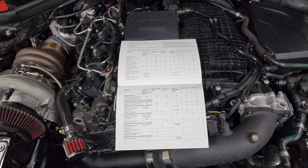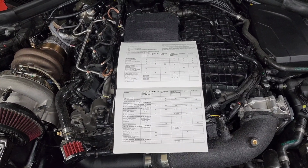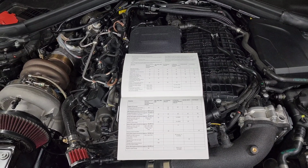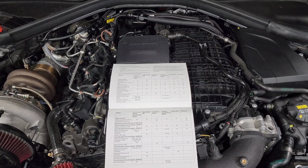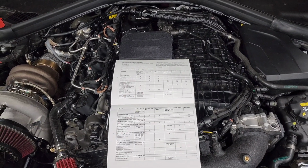The actual fuel dilution was pretty low, but depending on your driving style and things like that, that might be different. So again, if you're going to be running high ethanol content, full E85 or whatever, send your oil out for analysis. Make sure that your oil change interval is good enough, and that'll give you the confidence you need to continue with your maintenance plan.